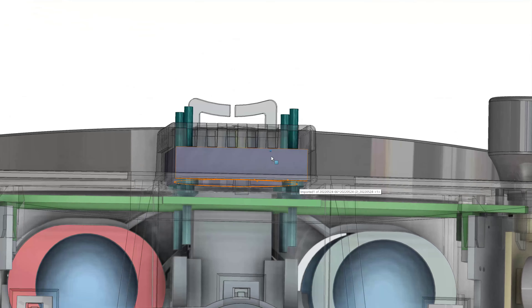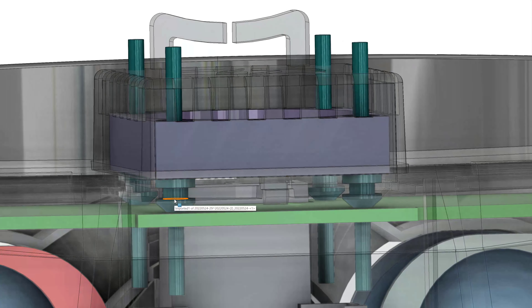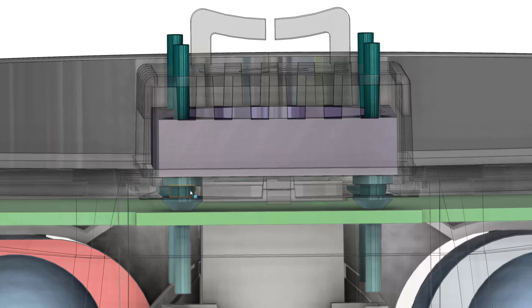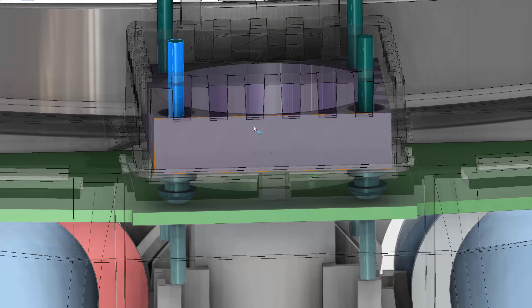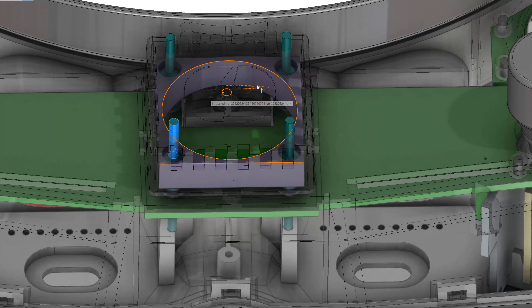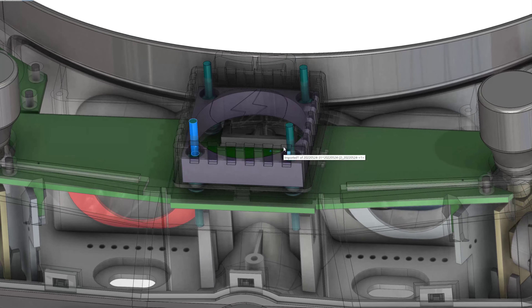This is how the top fan is mounted — with a similar rubber mounting system where it's in between the plastic on the top. The excess rubber piece and the upper part would be cut with scissors and removed. That gives you a floating, soft-mounted top fan that will remove sound and vibration. So it should be nice and quiet.